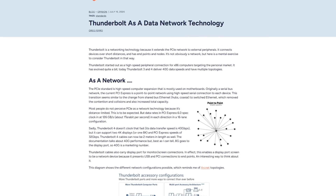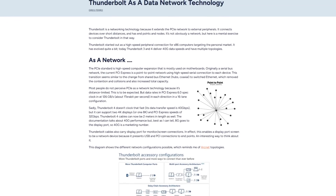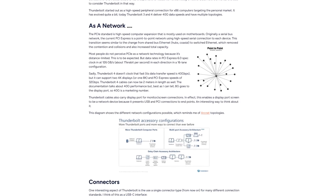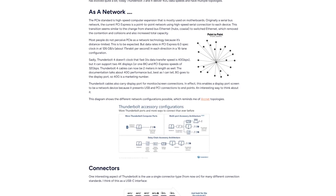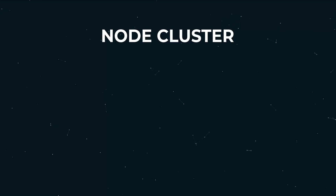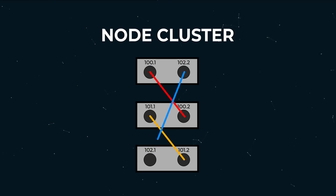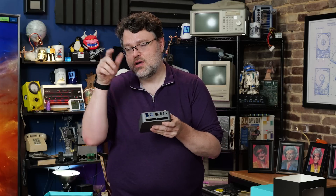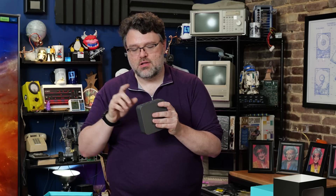If you're feeling really adventurous, let me introduce you to Thunderbolt Networking — it's USB 4, it's PCIe tunneling. You can actually use this to fully connect three of these nodes at what is effectively an 18 to 22 gigabit interface. Both ports would give you an internal 20 gigabit connection between all of those nodes, and then each one has its own two and a half gig connection to the rest of your network. You can use a Type-A port for storage on each of them. You can do a full CEPH cluster with 32 to 96 gigabytes of memory in each one. This is an amazing home lab.